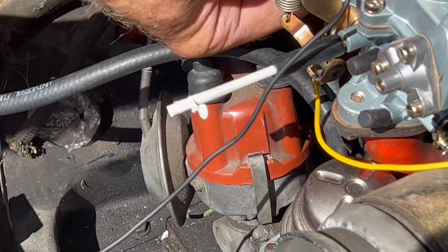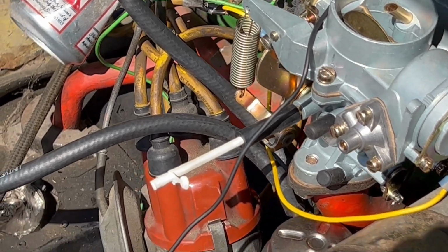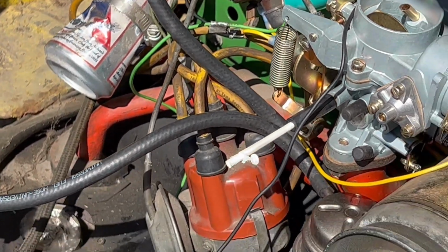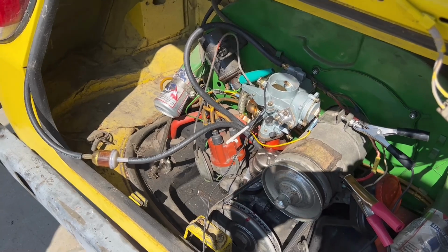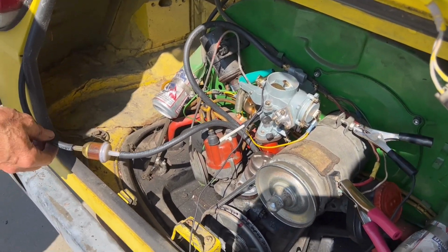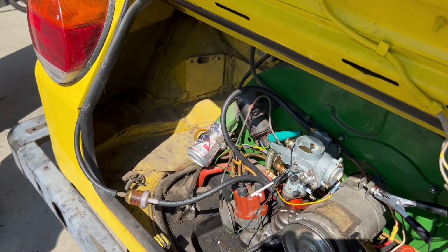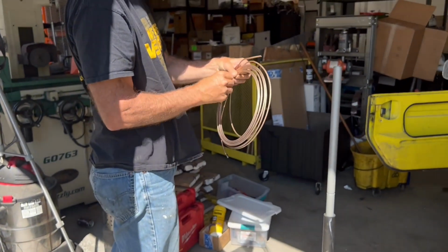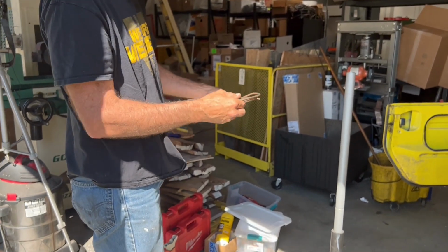We need these vacuum lines are shot too. I have some in my bag. Oh, great. I just bought it because I need to replace some on my car. Yeah. Bell Metric. That's the... Oh, yeah? For all these metric lines, and not sponsored. You're not sponsoring the metric system? No, but Bell Metric. Oh, Bell Metric. Bell Metric for fasteners. Oh, okay. Good metric fuel line. Because people use 1/4-inch line, but 1/4-inch line and 5mm line is not the same thing. Yeah. And you know that copper tubing is probably 3/16 or 4.76 millimeter. Yeah. So I have this proper 4mm tubing from Bell Metric. Oh, okay. I think it's 4mm. Oh, so my copper is a little too big in diameter.